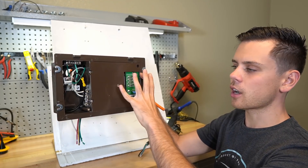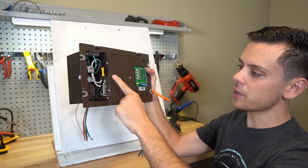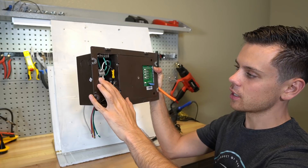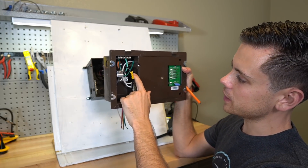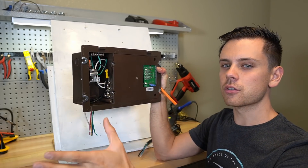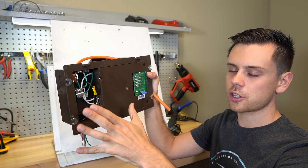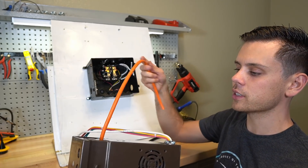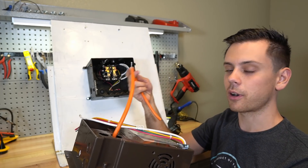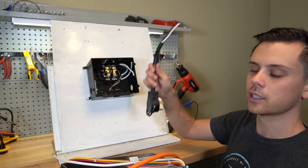Now I've taken off the cover of the converter box. We have the DC distribution panel and the AC distribution panel with the RV power plug connection. I added some crimp connectors and put the ground and neutral in here. If your RV comes with a converter box, do not take any of this off — just find the big cable coming out the back, which is probably black, and follow it to your RV power plug.